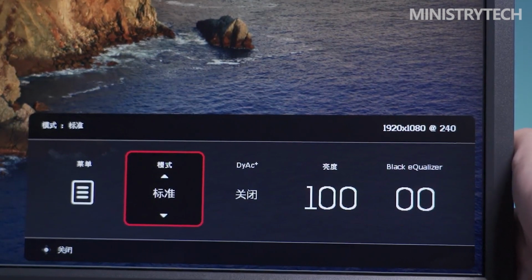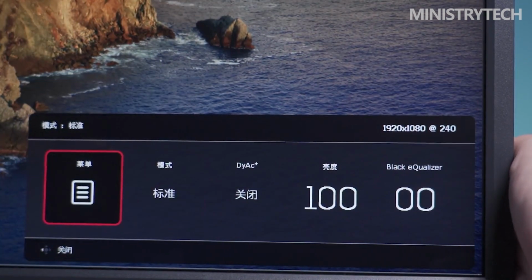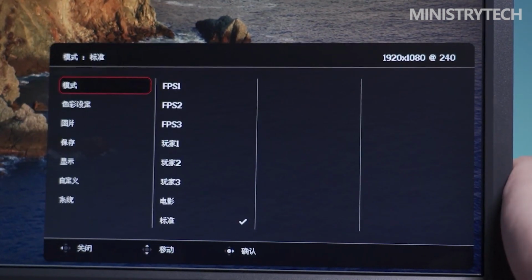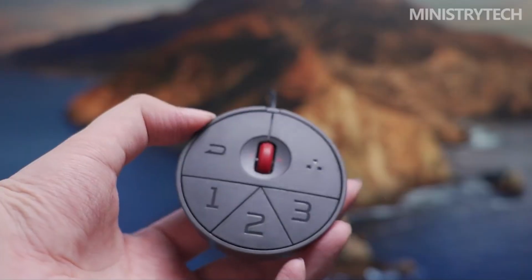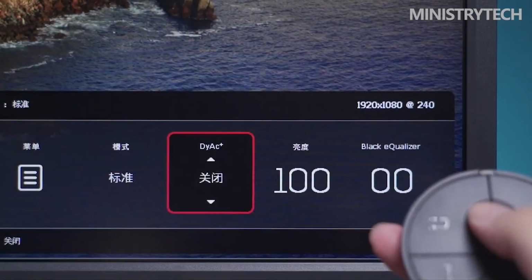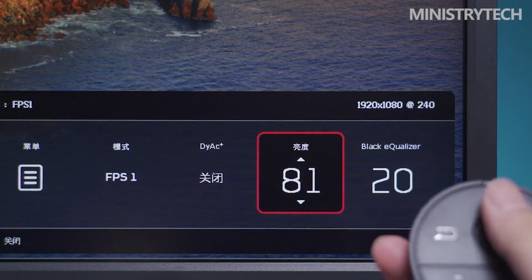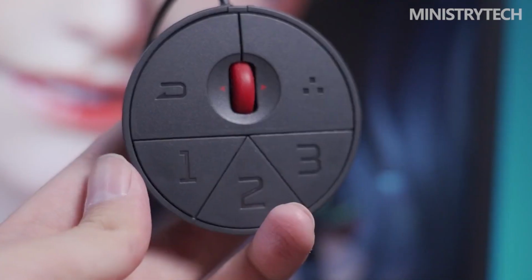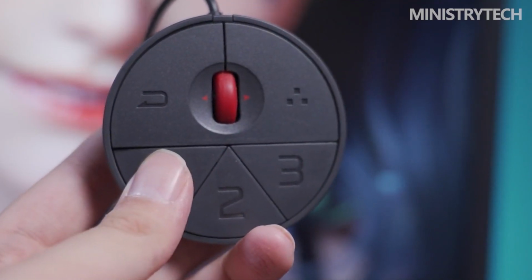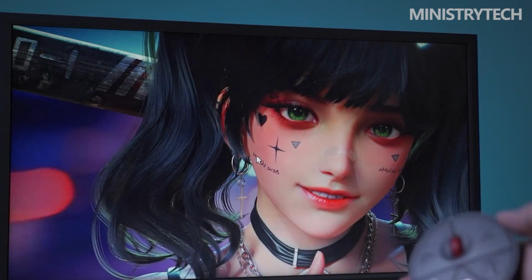After calibration, the monitor's performance marginally improved, but the XL2746K is still unable to compete with displays like the Samsung Odyssey G7 or the LG UltraGear 27GP950. The monitor only supported 74% of the DCI-P3 color space, and 94% of sRGB, when I tested it with the Datacolor Spyder X Elite. The Spyder X Elite scoring was subpar as well, particularly in terms of brightness uniformity and color accuracy.